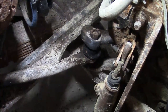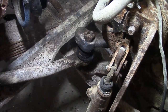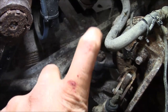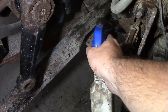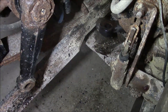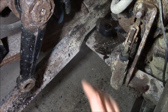A little bit of heat and the other one popped loose too. Sorry, it's a little tight in there — hammer, a crowbar, and patience. Same process as the other one: heat up the knuckle a little bit, push the two apart with the pry bar, and then a good whack with a hammer. Pro tip: a lot of people think you've got to hit down on top of the ball joint, but usually it's best if you hit on the side of the taper — that'll bust the taper loose. And don't get too anxious to throw in that new drag link. You've got to give these arms a chance to cool down. If you're still getting smoke when you spray liquid on it, it's too hot. If you go jamming that new link into the taper while it's still hot, the next guy's going to have quite a time getting it apart.